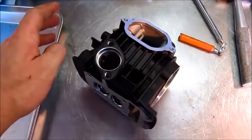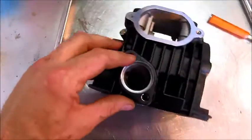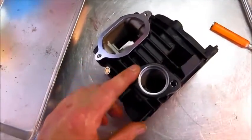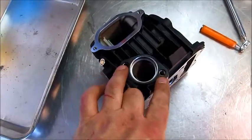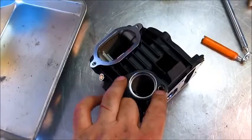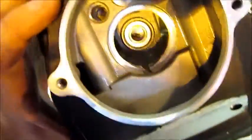I'm working on this Finber Racing 4-valve cylinder head for a Honda Grom — it's one of my buddy's bikes. I found a few problems with it. It's mostly looking like oversight when they did the powder coating. There's a lot of powder coat in the intake and exhaust stud threads, the narrow band port, as well as the spark plug threads. That wasn't that bad — you just throw the right tap in there and clean it out, not a big deal.